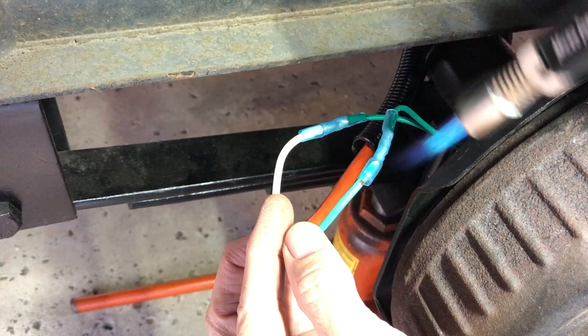I think we're good to go now — we'll just button this job up and call it done. We replaced all the magnets and brakes to possibly solve it, but today we've without a doubt confirmed a short circuit on the wire inside the axle. We've upgraded from that rather wimpy-looking cable rubbing inside the axle to something more substantial, double-protected on the outside of the axle where it can't be harmed by abrasion. It is outside the axle, so there's a possibility it could get snagged, but I've done everything I can to prevent that. The wire inside the axle was a definite problem — I still think this is an upgrade.